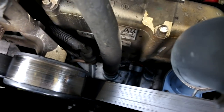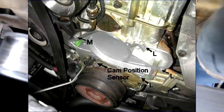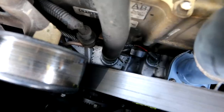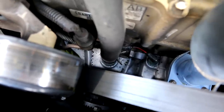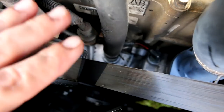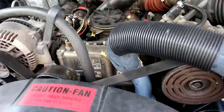Nestled underneath the water pump is the crank position sensor. It's buried under there and hard to get to, but it sits right underneath the weep hole of the water pump. About six months after my water pump went, the crank position sensor failed as well. I was at highway speed when it completely shut down the engine — when the engine can't figure out where the crank is, it just shuts down. The crank position sensor is a cheap enough fix, but do not go aftermarket. The Chinese knockoff versions do not last at all — I was warned by many people online, followed their advice, paid a little extra for a Ford product, and it has been rock solid for a couple of years.